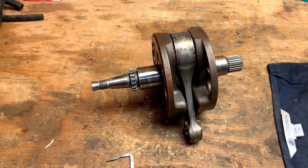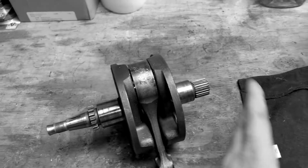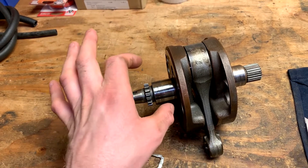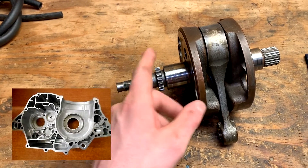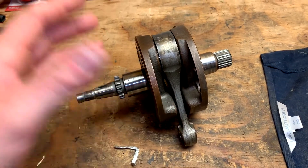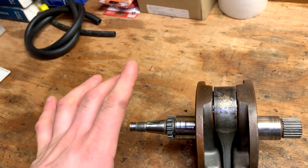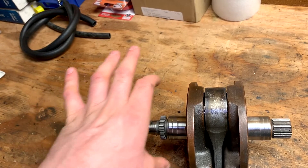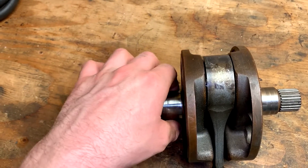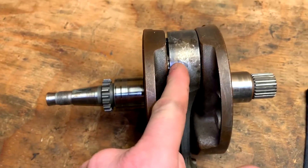I have a crankshaft removed from my 2005 TRX 450R. You cannot interchange a 2004/2005 crank with an 2006 or newer crank — they're totally different. On the 2004/2005, there's a bearing pressed into your left case half, and your crankshaft requires a special tool to get a press fit. Your crankshaft is locked into place using the left crankcase. Over time, heat cycles cause the aluminum to expand and contract, and eventually it doesn't contract enough around the outer race of the left bearing. It lets go of that left bearing, the outer race eventually releases, and your crankshaft walks side to side. Your weak point is going to be right here — these thrust washers.